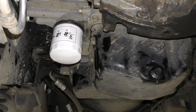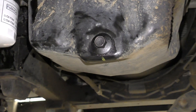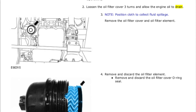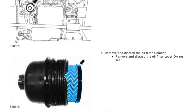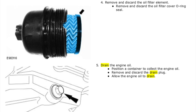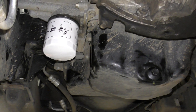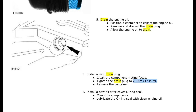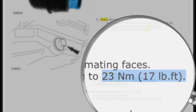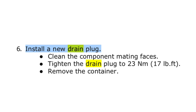The customer has authorised a full service, which includes engine oil change, filters, and the such like. Drain plug is here, 13mm spanner. The workshop manual will give you the details. I'll show you an older type filter which is relevant — this is the Ford type plastic cap with a disposable element. However, this vehicle we're working on doesn't have it; it has a spin-on filter.